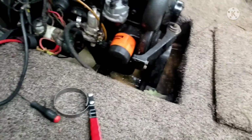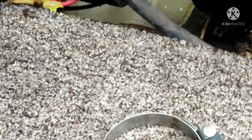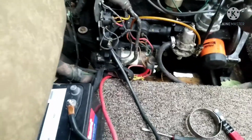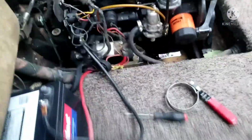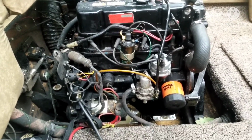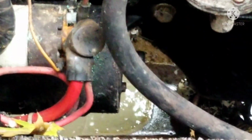So yeah. Whoa, whoa, whoa, guys. When I was turning this motor over, this is what I discovered. All of that milky oil started coming out when I was turning this motor over. It turns out that there possibly is another leak right there where it's dripping. As you can see, there's possibly another crack in the block, which I did not scope out. And that's a shame, all that time and work just for another crack to form.